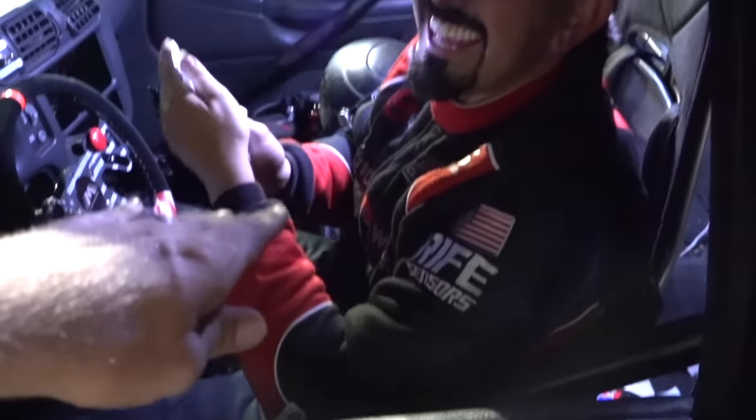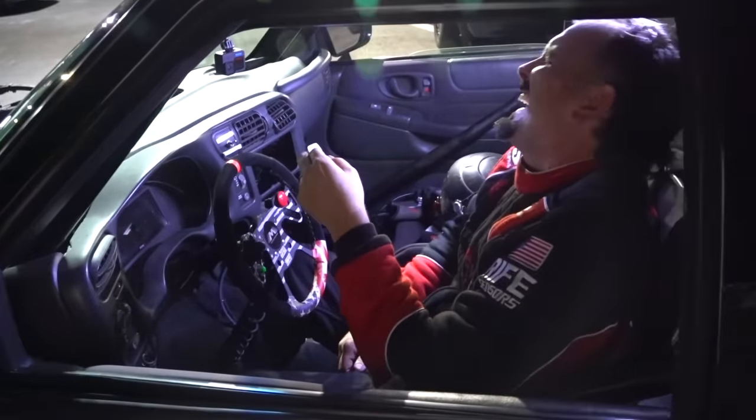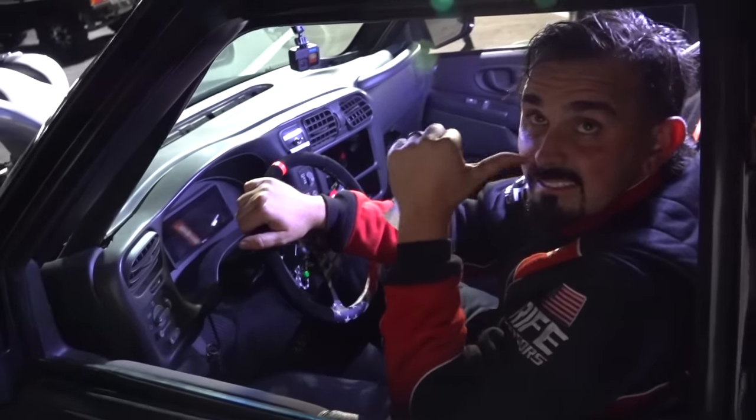Listen, you just keep doing your thing. Jack, Stan, and I got this under control. Yeah, okay. Wait for our next stunt. Yeah. You got a spare crankshaft? We're going to figure something out. That pulley on it, I think. I think you're going to definitely have to lower the boost. Left the tune alone, tighten clutch. Perfect. We're gonna see if that just gets it moving, gets it boogieing a little faster off the line. Tighter 60 foot, you know. All right. The engine's making a lot of power, so we just gotta utilize it better with the clutch, I think. And then keep going from there.